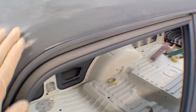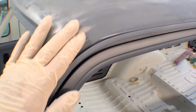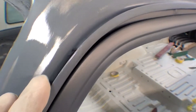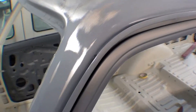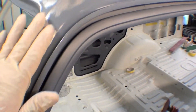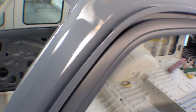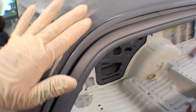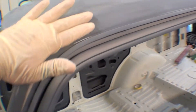Here's one of the areas that we always notice on an FJ62 — it's very odd shaped from the factory. There's a brass strip across there where they weld the roof panel to the windshield post. As you can see by running a straight block across it, this shows you all the highs and lows. You can see down through here it's very low in comparison up here, and you can feel the transitions.